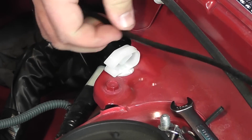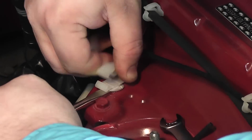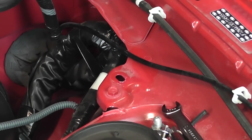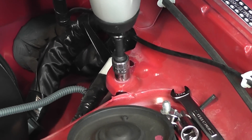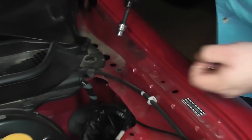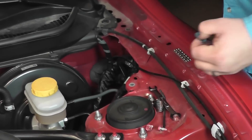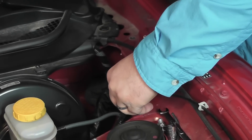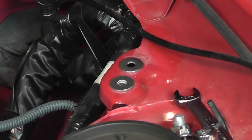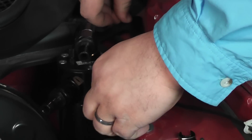One of the first things we have to do on this side is remove this tab that's holding down the cable for the trunk release — it kind of unclips. We need to remove these bolts. On this side, we actually need two washers because this hole is oversized over here, so you need both washers in order to get the spacing right. Do a little test fit here.